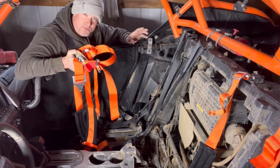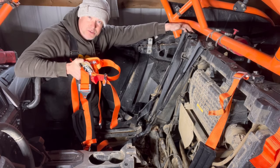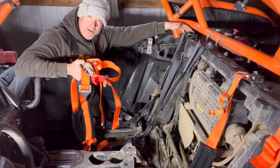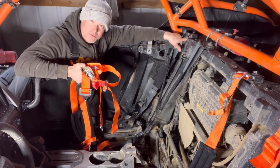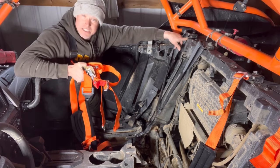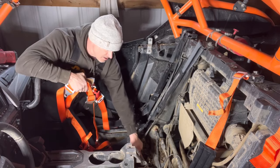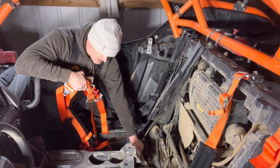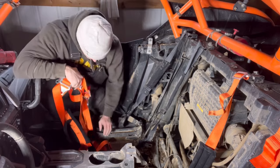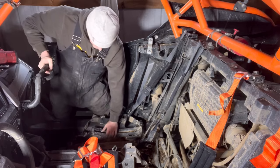They're not too difficult. I got a roll cage here so it's in the way of my bolts coming out, so I have to manually do these. These are an 18 or 16 millimeter on top, and the bottom ones should be a three-quarters or an 18 — I use the three-quarters because they feel a little better and snugger in there. Then you come down here and take these bottom bolts off, which are kind of hard to see, and these are a 16 or 18 too. Then you come to the front and you got another set of 16-18s over here.